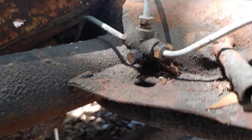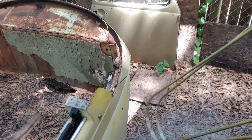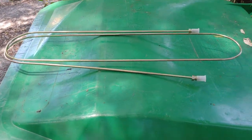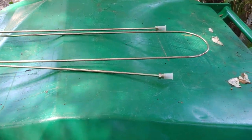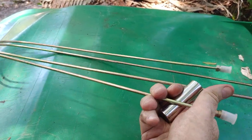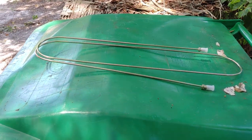Here's a tip and trick to do this job: when you get the parts in the mail or from your parts supplier, the main line is going to come pre-bent. I watched a couple of YouTube videos — check out a channel called Slades VW, S-L-A-D-E-S Beetle. He has done this job on a '73 or '74 Super Beetle and from what I understand it's just about the same. What he did is he took a socket and used it as a bender to help re-bend your lines. I still need to order a couple parts to complete this job, but that's what we've been doing here on the 1972 Super Beetle.